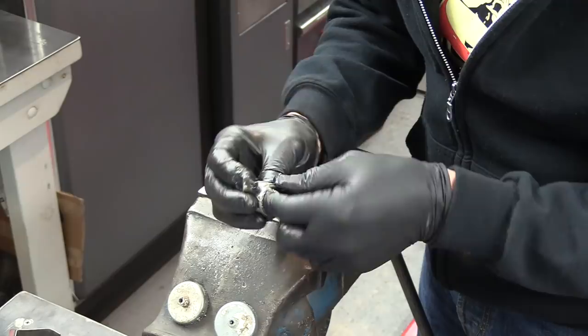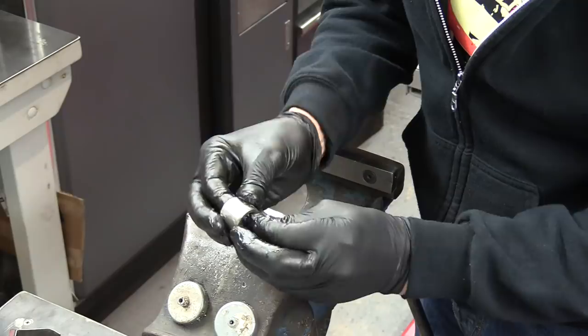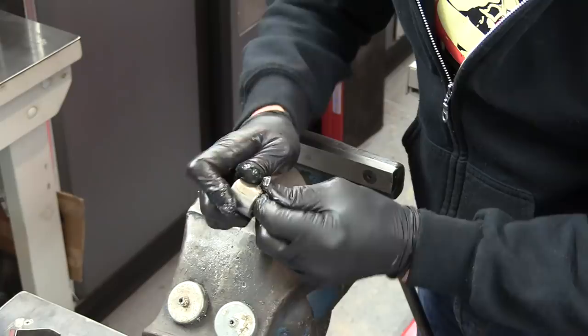There, that big old blob of grease is all gone. You can sort of see there's a residue everywhere, but that big blob that I put in is all gone inside. So it's really important, absolutely vital, that you grease up these bearings and work that grease in, push it all in behind the rollers. Some people even said heat them up so that the grease goes soggy.